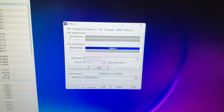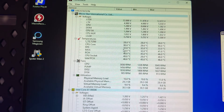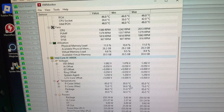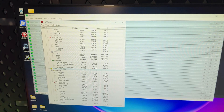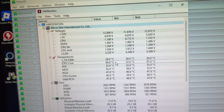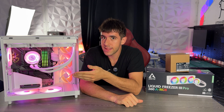There's a dramatic temperature reduction even on the CPU-Z stress test, and we get a little extra performance in benchmarks because we're no longer throttling. The actual performance delta is more than 12 degrees because it was throttling at 100°C — it probably would have gone to around 102–103°C, so we dropped around 15 degrees by maintaining the same radiator size, simply by getting this cooler. We also dropped 10 degrees on the socket temperature.